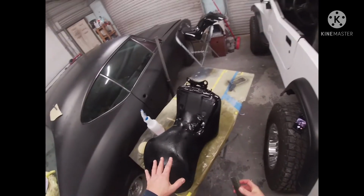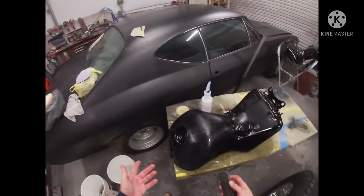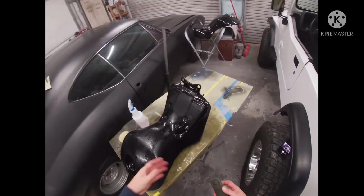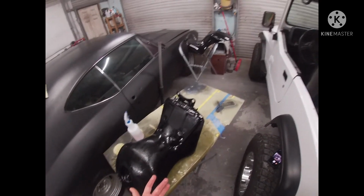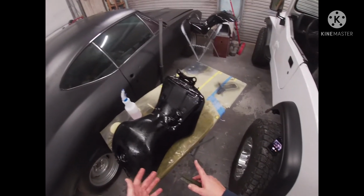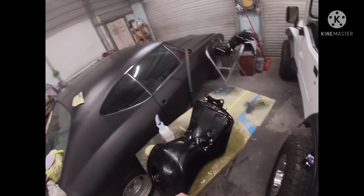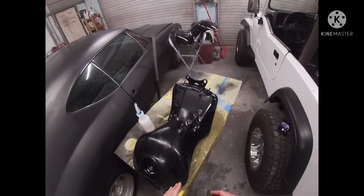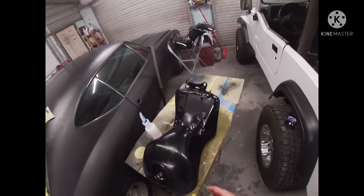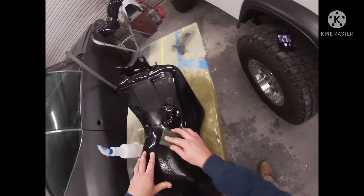Like I say, from this 1500 with 3M polishes, you can usually buff out 1500. The stuff that I use is the Meguiar's 105 and 205. The 105 will bring out the 1500. And Presta Ultra Cutting Cream, that's a water-based product, will also bring out the 1500. Like I said, with it being black, I like to refine the scratches, go with 2000, maybe 3000. We'll just see how it comes out when we get it all done.